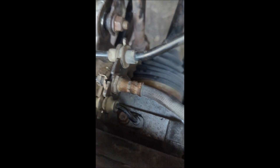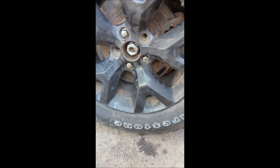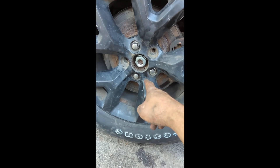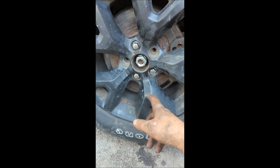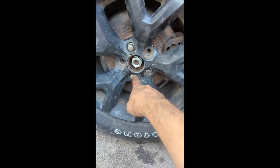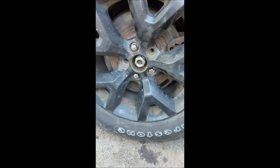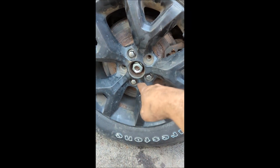When you put the brakes back on, be careful not to twist your lines. Look at the striations and make sure they're nice and smooth. I put a couple of bolts in so it doesn't rotate, then run it in with the impact just enough to get the touch, and then torque it to the spec sheet — only let it click once, because if you keep tightening past that you will damage the bearing. After torquing, remove the wheel again, stake it if you have that style, then reinstall your cap and put your lug nuts on torque to spec.